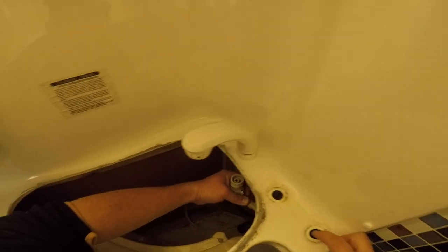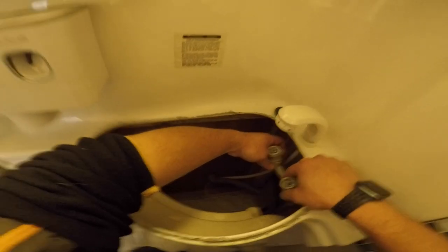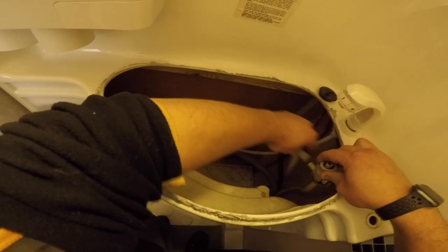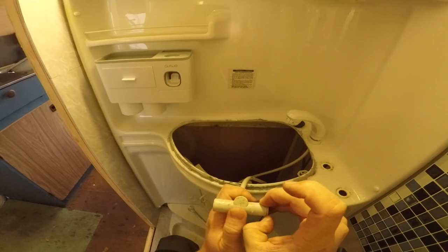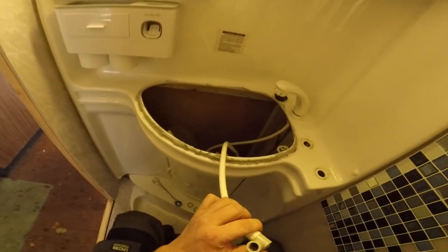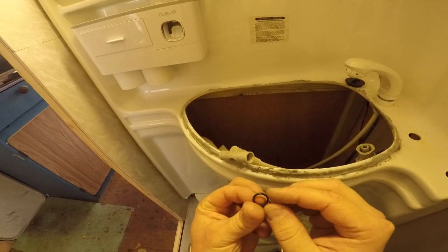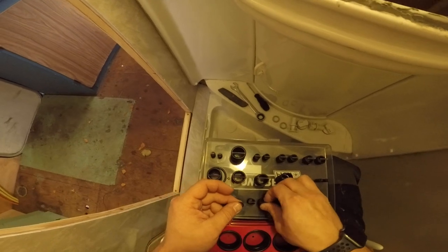I think these were designed for systems with zero pressure - this just came out like that, this is weird. There is an o-ring there but it's obviously not tough enough. These come off too, and the o-ring sits inside there. I do have an o-ring set and I'm just gonna replace both of them. This is the o-ring - I can see it's flattened. It's behind this lid here and when you take it off it flies, so beware of that.